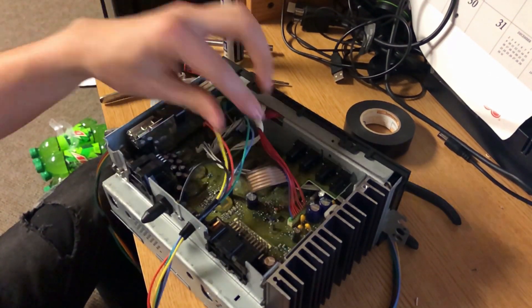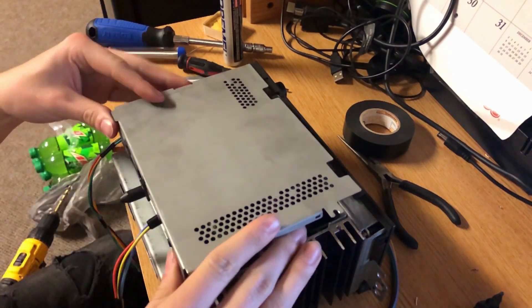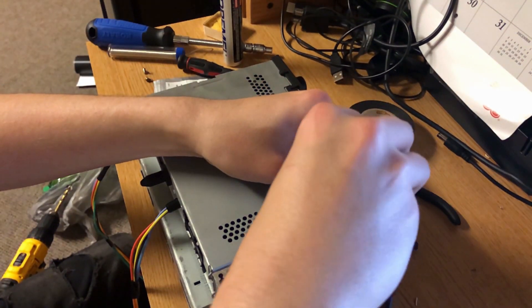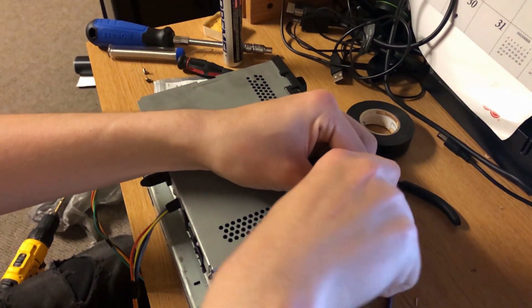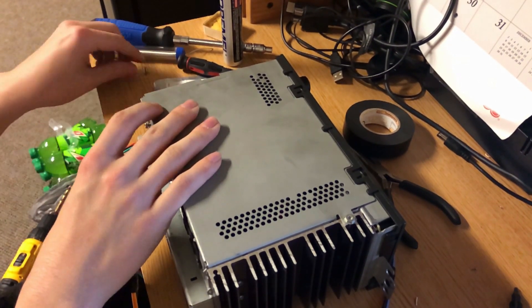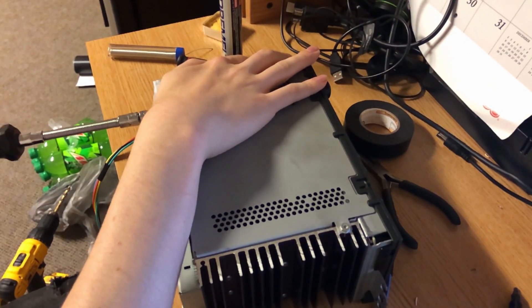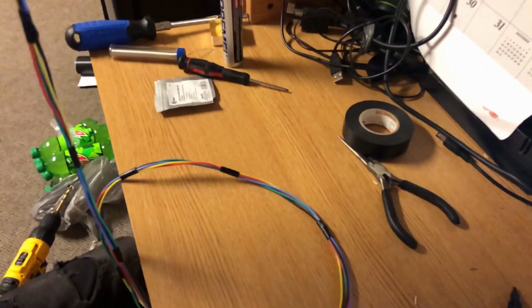I chose here because it's already a factory ground for the circuit board. If you kind of wedge open, there is a metal plate between the chassis of the head unit — you can just pry those out together and stick the ground wire right down in between them, so it's nice and tight and has good contact to metal. That was the best option for a ground I could find. Of course, you can always set it up to a different ground as long as you have good contact to the chassis of the head unit casing.